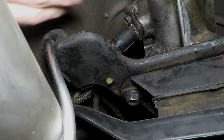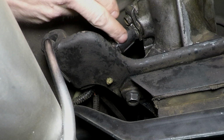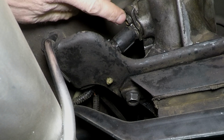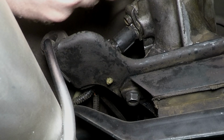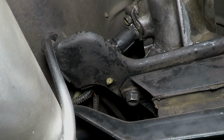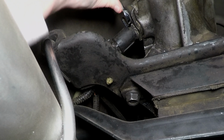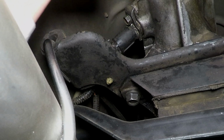Okay guys, so we're into the car here, and this is the speedometer cable, and where it bolts into your T5. So what we're gonna do here, well, Sadie's gonna do it for me, but we're gonna back this 7/16 bolt out, which will ultimately allow us to slide the speedometer cable out of there. So, okay, buddy, you can get in there and get that guy loosened out. There you go. You might want to flip your hand around. Oh, you getting her? Oh, no, don't tighten it again. There you go. Now take it off. Yep. Put her back on there again.